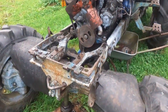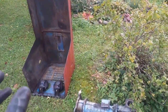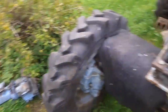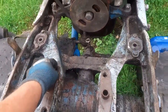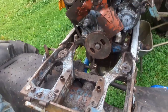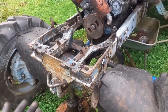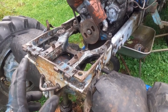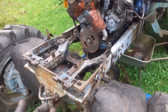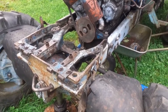I removed the old steering post and the hood. The hood isn't really the problem — you can lift it alone, though this one's a bit heavier. I also cleaned up the front bolster. These are the bolts we need to align. My idea is to try to swap it in alone, but you'll definitely need a hoist, a front loader, or at least two people. I'm going to fire up the red tractor and see if my plan works.